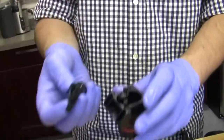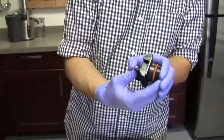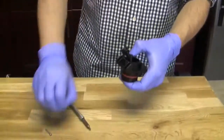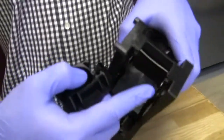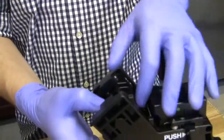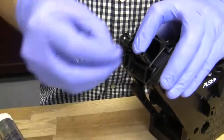You can actually buy those individual parts — we stock the glass ball and the spring by themselves in the parts department here at Seattle Coffee Gear. So I'm placing this right back on and it's easy to line up — you can see where the screw holes are. I'm going to push it in and that's holding in place with that O-ring. Wait — don't forget to put the screen back in first. So it's a lot easier this way — get it right in here, and once again you can see those four clips really clearly. We just put this up and you'll hear it clip in. Now we're good, and now you can screw this back on. That's pretty easy.